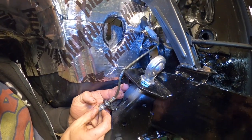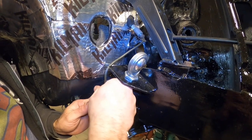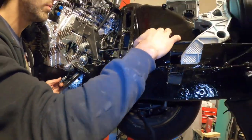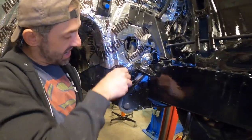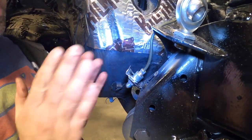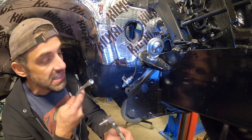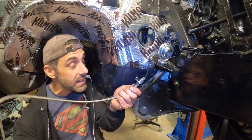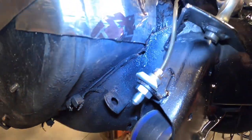Now the AN10 line is essentially just gonna come in like that, AN4 line, rather, and that just snakes in just like that. We tighten this, we tighten that, and then this is a clip in order to affix this guy just like that. Just hit it in place with a hammer, and this guy is going nowhere. So the entire assembly is going to be pretty easy to install. At which point, we're gonna take our AN4 stainless steel line, plug it right in there after the drivetrain is installed, and this guy will have already been snaked around the transmission tunnel and go right into the slave cylinder.